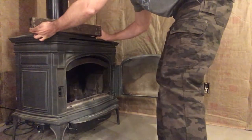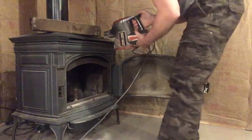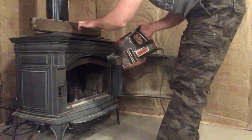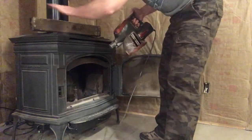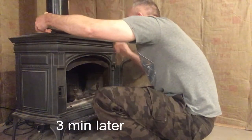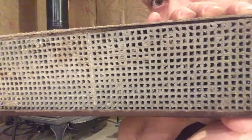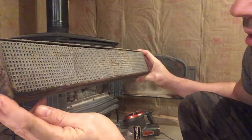You always want to keep it clean. Smoke is essentially floating ash and it'll build up. I try not to blow it through because I think a lot of this stuff is just on the edge. A regular vacuum cleaner should just suck this out. Along the top there's a thin layer of insulated fireproof foam — you don't want to suck that out, so I press on it from the top. I got maybe 80–90% of the dust, but some holes are still partially clogged.